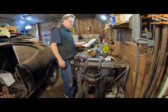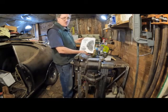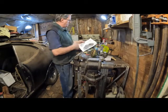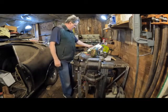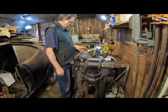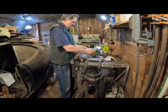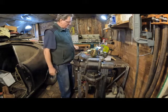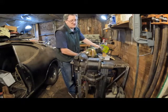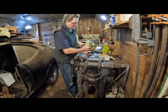Now I have this Right Stuff brake kit. It's a conversion kit to put disc brakes on the front of the '68 Oldsmobile. Also works on A, F, and X bodies. There are some things about the kit that make it a little bit difficult to do, but not particularly. This is a picture so you can see how the brackets go on, because the instructions aren't the best. But this is how the brackets go on.